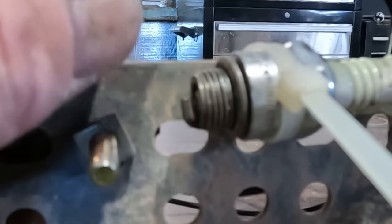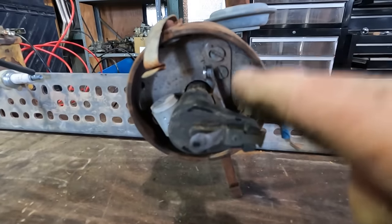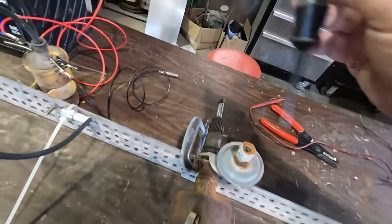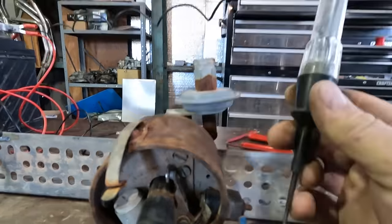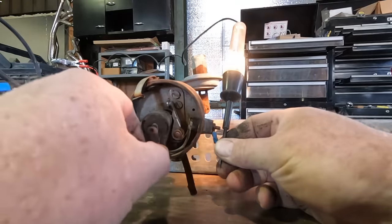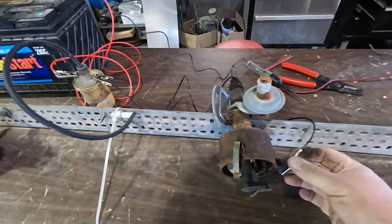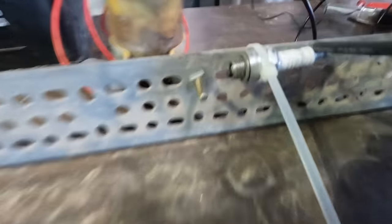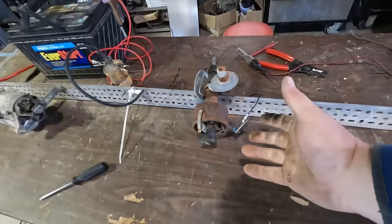What we need is a switch that runs off the engine itself. This is a points-type distributor, named so because it has breaker points inside — effectively a switch. The body of the distributor is installed in the engine, and a gear drives off the camshaft in exact time with the engine. The points open and close: when closed, the terminal connects to ground; when open, there's no connection. As the distributor spins, it turns on and off for every cylinder. Take the ground wire from the coil, hook it to this terminal, and there we get our spark. This is a basic ignition system that works.